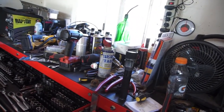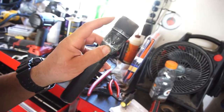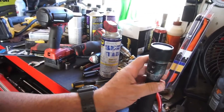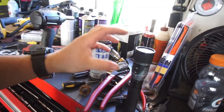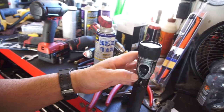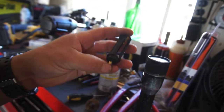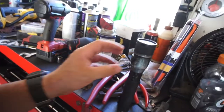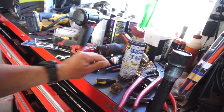I do know what the deal is, and I fixed it. I took the top piece off — it's kind of a pain — you take the top part off, there's a little disc in there, you take a pick and spin it out, undo two screws, and this little internal thing comes out. There's a positive spring and what I'd call an eject spring — this spring was super corroded, so I took some emery cloth and cleaned it up.